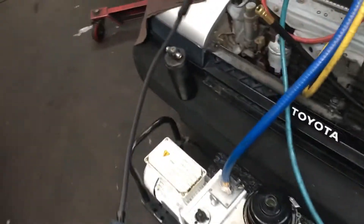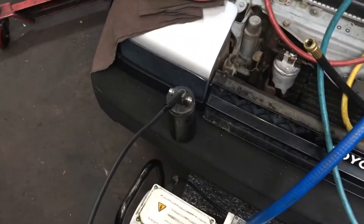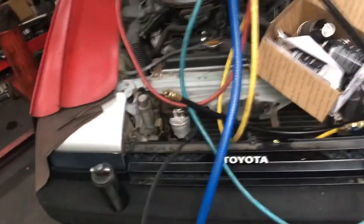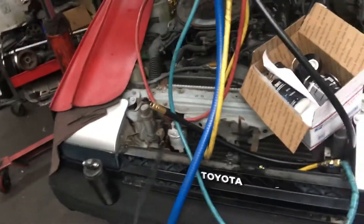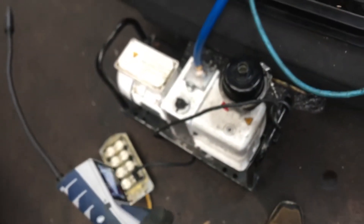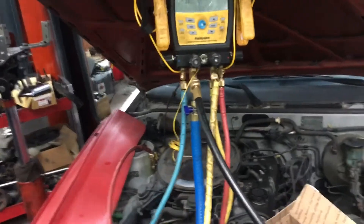I'm just leaving a day. Remember in the last video, it was leaking from the top of the o-ring at the sight glass right there. So there's the new receiver dryer — what it should have had in the first place. That was the first thing when I walked up to the vehicle. I said replace the receiver dryer, but the customer didn't want to. It was leaking from the receiver dryer. I might just leave it on the vacuum pump overnight and give this guy a good dry system.